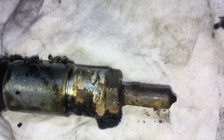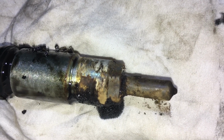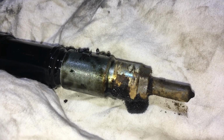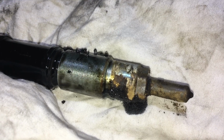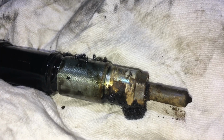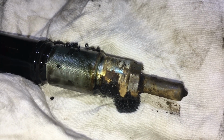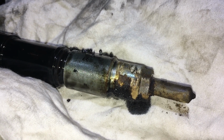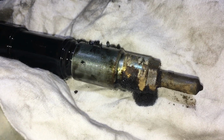What we dealt with is, as explained, the beginning of blow-by, right? And the first thing that happens here is the injector seat starts leaking. Checking your oil pickup at this point in time, or any time soon after now, even the next couple thousand Ks, maybe even 5 or 10,000, is going to tell you absolutely nothing about what's happening with these injector seats. That's why you change them as prevention, right? You know, the 170K thing, 7 years, 170, general guideline.